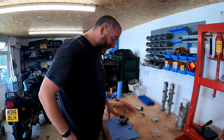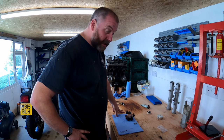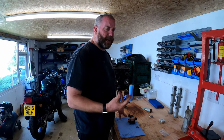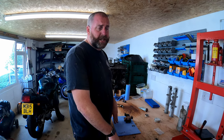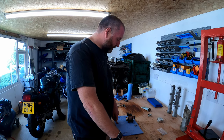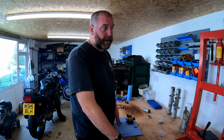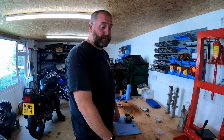I have another front one to do yet — that'll be another video. The brake disc on the back of the SV does need replacing; it's quite thin and although I haven't measured it I'd imagine it's below the minimum thickness recommended by the manual. The wheel needs a good blast and a powder coat as the dirt is simply ingrained in the paint. So I'll get that all done at some point, get a new disc on there, and then reinstall the caliper later. Hopefully you enjoyed this video and found it useful — please feel free to leave a comment below and join me on the socials. Links will be in the description, as will links to all the parts used in this video. Take care guys, see you all again for the next one, bye bye now.